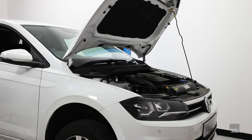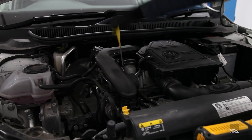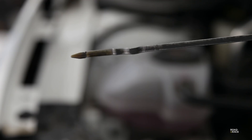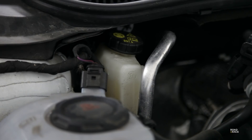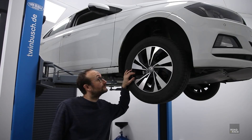Onto the fluid levels: coolant level was okay — the coolant in this car is less than three years old so it doesn't need changing. Oil was fine too, it was just changed six months ago. Brake fluid I changed myself about six months ago so that was fine. Screen wash is always low — I topped it up but they've only got about a one litre tank for screen wash in here, which is a bit ridiculous. Anyway, I topped that up.